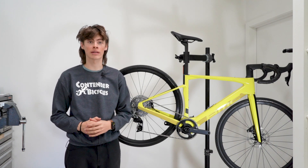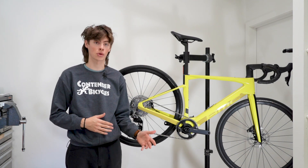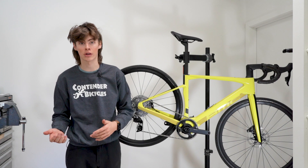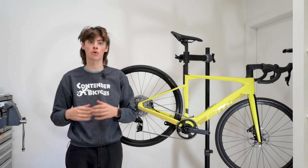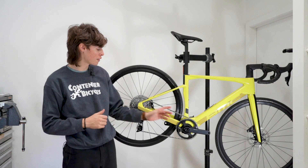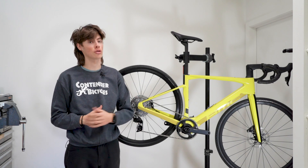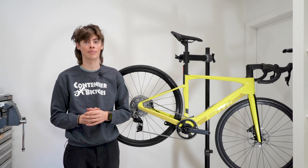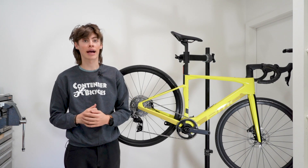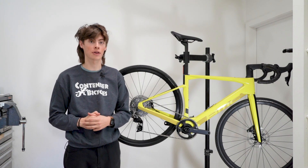So if you're looking for a bike that rides like an e-bike but also feels a lot more like your normal mountain or gravel bike, this is one of the ways to go. Because it's so quiet, it's harder to notice that it's there — you're not going to hear it whine as much, that kind of motory noise, due to its lower torque levels. The lower torque level on this motor at peak torque is 50 Nm, which is 15 Nm shy of the top peak torque on the Orbea Rise, and even more shy of the 85 Nm torque we see on a couple of the really big full-powered e-bikes we have here at the shop.